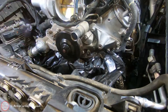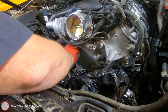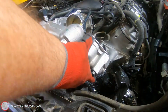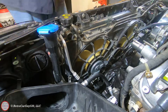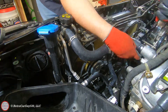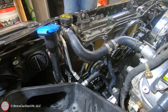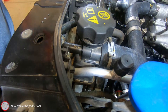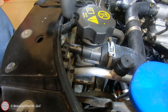Now I'm removing the original water pump, which has end play in the driveshaft — that's why it's being replaced. Getting the gaskets off, cleaning the surfaces of residual gasket material, and then installing water pump number one. I found the replacement water pump had a defective wobbly pulley on it. Then I ran into a situation just after getting the upper radiator hose with the bypass hose installed, where I installed the upper air bleed hose by the radiator cap — and you'll see what happens in just a moment. It goes well up to this point, and then in just a second here you'll see it.